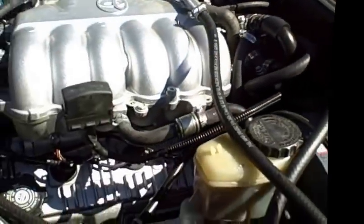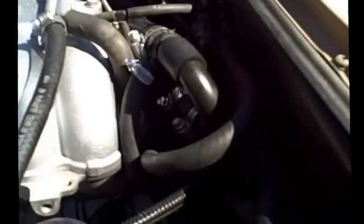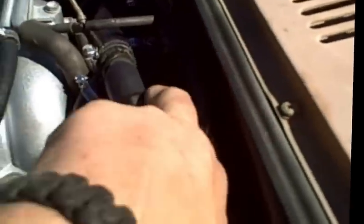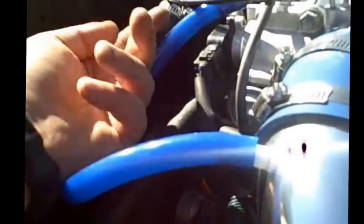But hooking these things up, it's important to keep in mind that for the 97 engine, on the back of your radiator hose on your engine, it's going to go passenger side to the inlet back here on your intake heater control. Then that's going to go into your firewall. Then your driver's side on your engine goes to the passenger side on the inlet. I'm sorry, this is the part coming out, this is going in, this is coming out. So that's important to keep in mind.